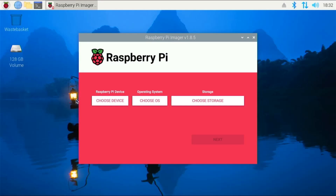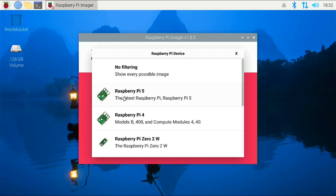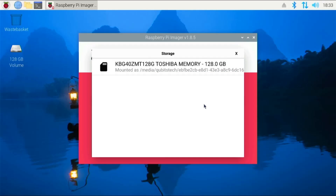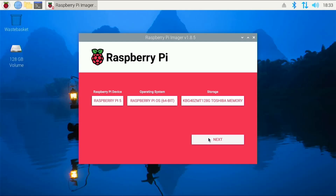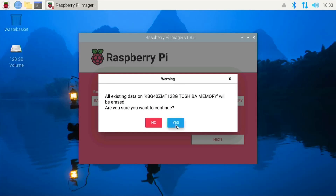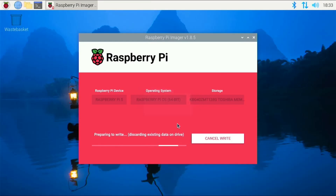To install the OS, I'm going to use the Raspberry Pi Imager tool, though you can use any method you'd normally use to flash an OS onto a drive. First, select the device — that's Raspberry Pi 5. Then select the operating system — we'll go with the 64-bit version of Raspberry Pi OS. Then select the drive, and as we can see, the 128GB SSD is showing. Click next, skip through the customization dialog, accept to wipe the drive, and enter your password. Now all there is to do is wait for the image to be downloaded and installed, and then we should be able to boot directly from the SSD.